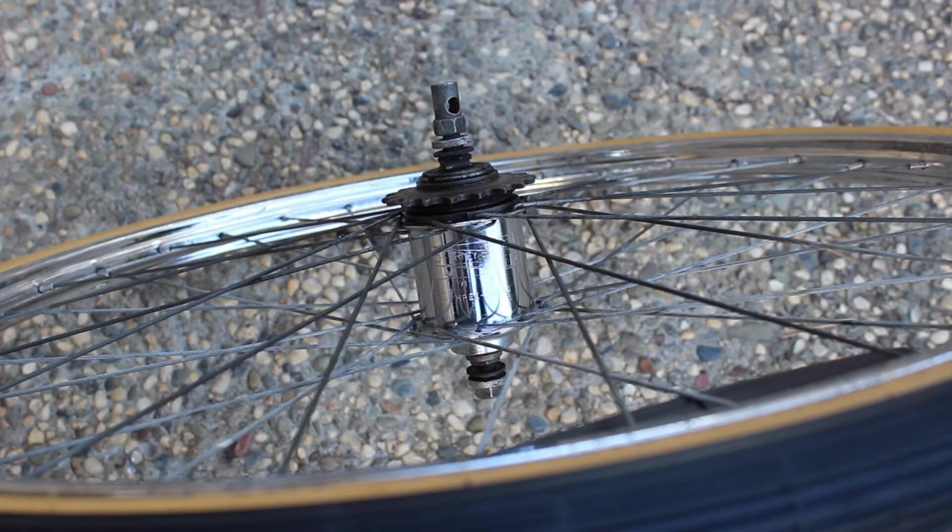The internal 3-speed hub was invented at the dawn of the 1900s when bicycling was in its heyday. The AW model was released in 1937. The A is for Type A, and the W is for wide range gearing. It has a 25% overdrive and underdrive from the planetary gear system, along with a direct drive in the middle position. AW is also known as Always Works due to the low maintenance, bulletproof nature of the hub.